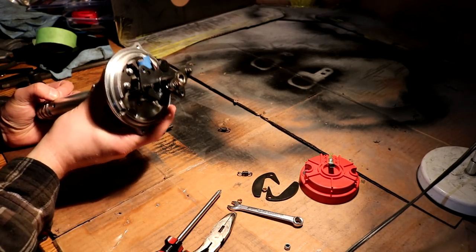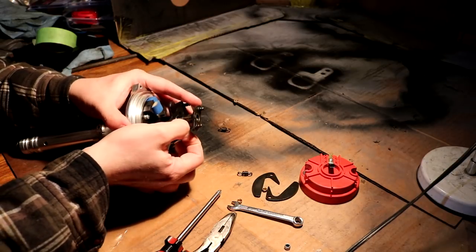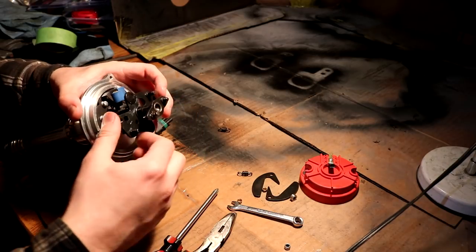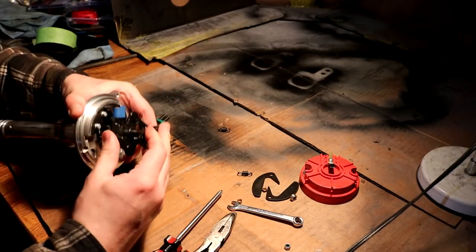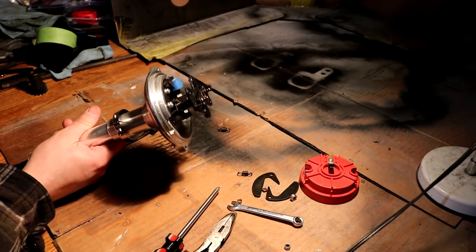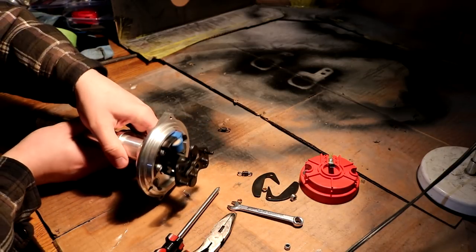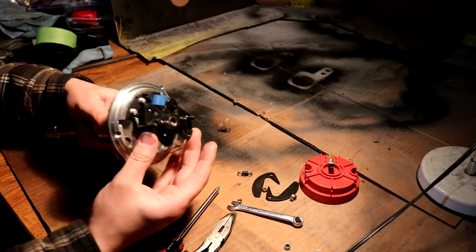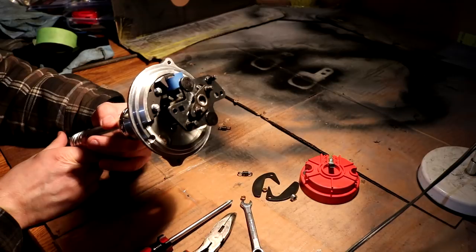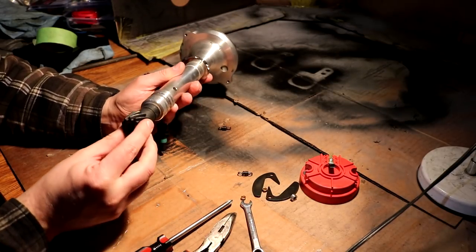Now I move up the shaft, pull out the bushing — that's the original stop bushing. I rotate this 180 degrees and push the shaft back in. And now you can see that when I turn it, there's no more mechanical advance. It is locked out. So with the distributor locked out, I can now reinsert my roll pin and continue with the installation.